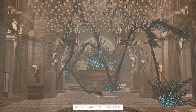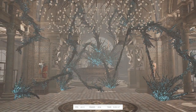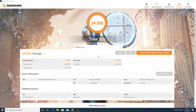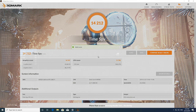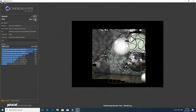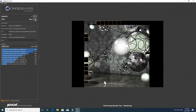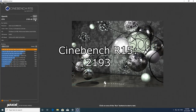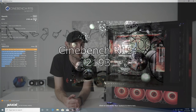Now, we had a lot of temperature headroom here. We're only seeing temperatures of around the sort of 75 degree mark under 100% load. So yeah, no issues with temperature whatsoever, and we definitely have some headroom there, but I just don't like running these particular CPUs any higher than about 1.35 volts for daily use when I'm not there to actually monitor it myself. But yeah, we were able to get 5.2 gigahertz at 1.41 volts. But yeah, 5.1 gigahertz at 1.35 volts there. And we were able to reach 5 gigahertz on all cores at just 1.29 volts.